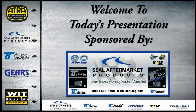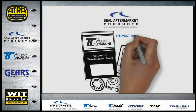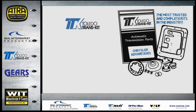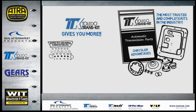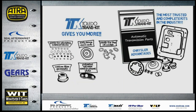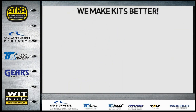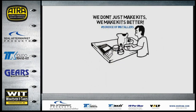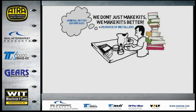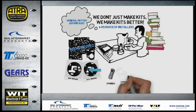Seal Aftermarket Products engineers and manufactures Toledo Transkit — the most trusted and complete kits in the industry. For 25 years, Toledo Transkit gives you more critical components, more OE components like premium seals and gaskets, more design enhancements, patented components, and all the little extras you won't find elsewhere. They include re-engineered valve body gaskets preventing EPC damage by eliminating shredding, plus spring and screen filters that should be changed at overhaul.